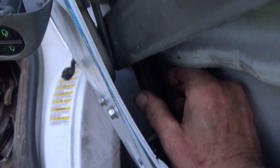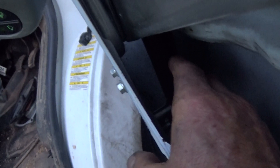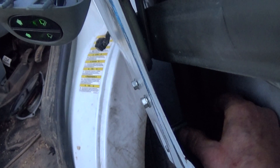Feed it in underneath and you've got to plug it in. Just keep going up and down to manipulate it and get around the back. You'll think it's not gonna go because of this window guide thing. When you see it, don't try and pull it or push it — twist it. If you twist it, it'll go. It is a ball ache but it will go eventually. Just keep manipulating the buttons up and down to alter the angle of the arm and you'll eventually get it in.